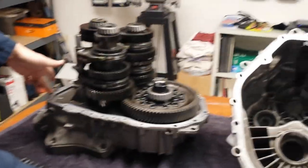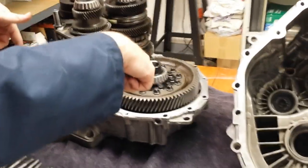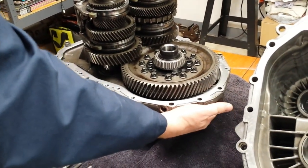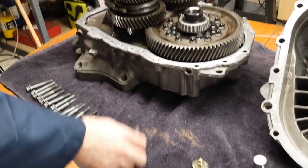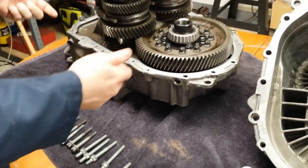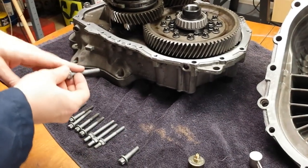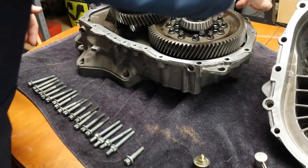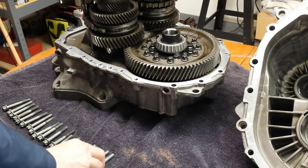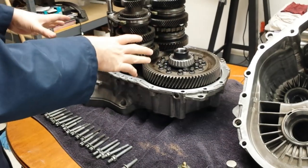Most are accessed from this side, from the driver's side, opposite of the engine. There's a couple from the back, and there's one tricky one, bigger than the rest, that's inside the clutch housing. Don't forget about that one, like I did, or else you'll wonder why it won't come apart. A couple of them are studs on my particular transmission — four of them. I made a mark with a Sharpie on the transmission case so I remember where those went.